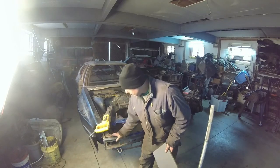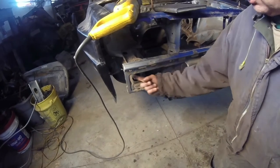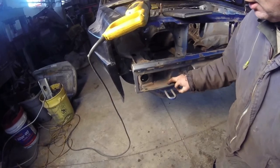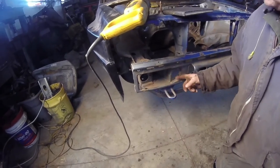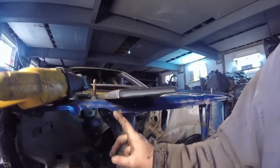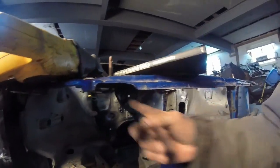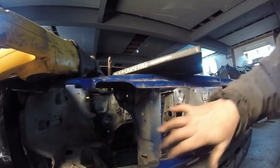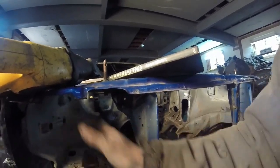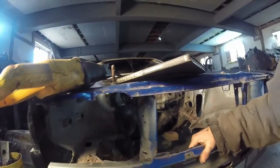All of this sheet metal down here I don't need. It's attached to these front legs or front horns — resistance welded down here and up in here. What we're going to do is take the Sawzall, cut down here, cut right here. All the sheet metal will be saved. I'll build my own setup, my own box section to put the lights and so forth. Let me get right on to doing this — it should take about five minutes.